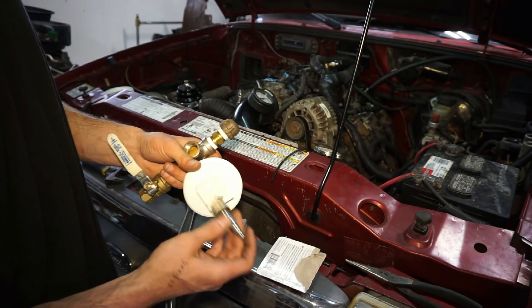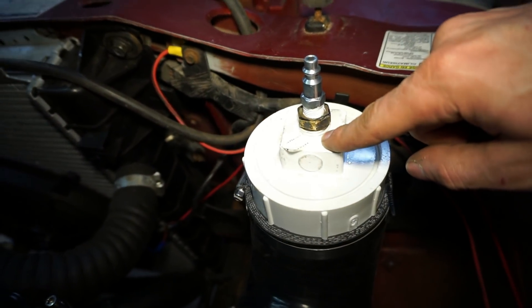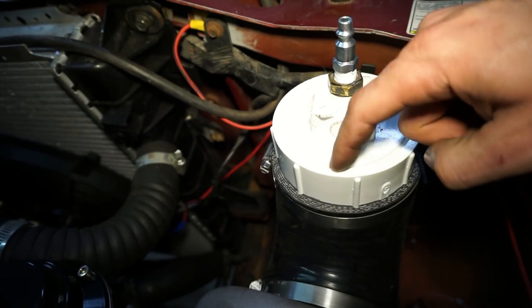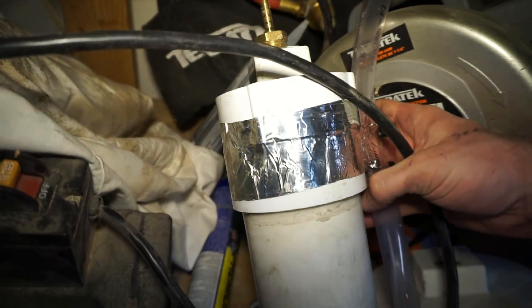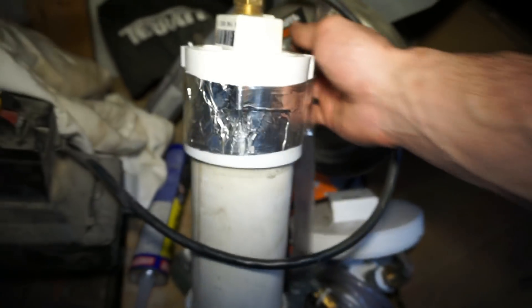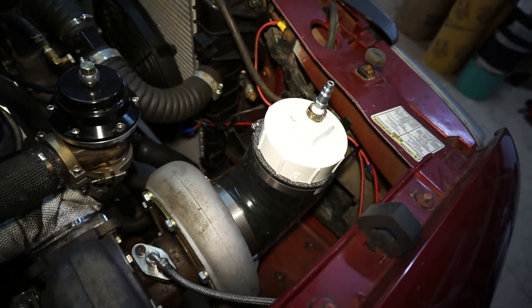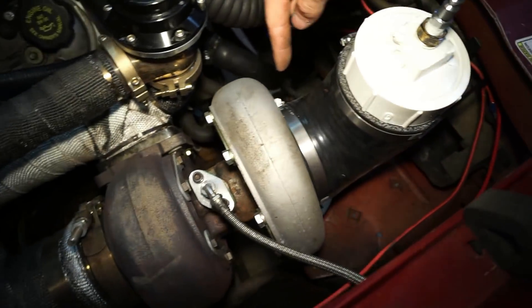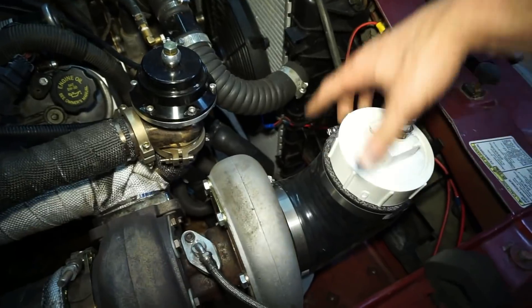The tester is pretty much all finished now. I did a half-inch NPT tap, then threaded in the half-inch to quarter-inch reducer. These pipe thread fittings still like to leak even with plenty of thread engagement, so I'm going to hook an airline up and test it. If it leaks from the tester itself I'm not too concerned — anything after the turbo leaking would be an actual boost leak. The tester itself is just a temporary piece.